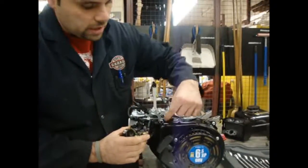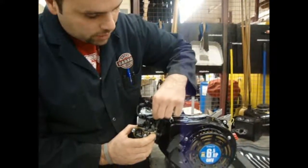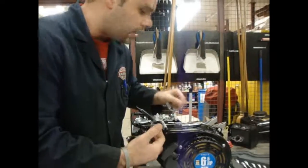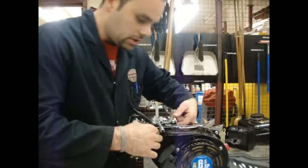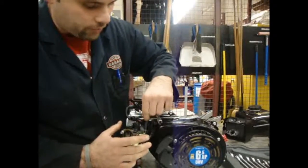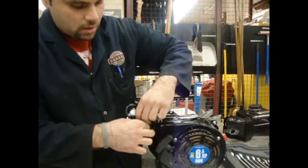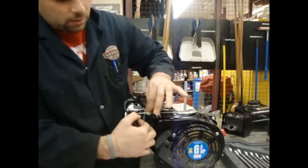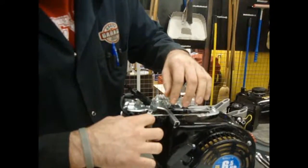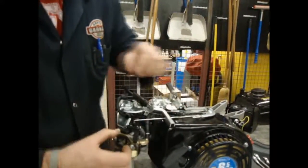Before I remove the carburetor, you can see there are some levers and springs attached to it. I have to remove those, and there's the fuel line which is kind of just loosely there — we're going to take the fuel line with the carburetor. So we've got these springs and levers which we have to remove. I'm going to remove this spring by simply pulling it off, being careful I don't break anything. Then I'm going to straighten out this bar and pull the lever right out.